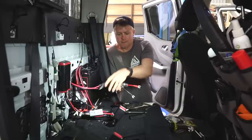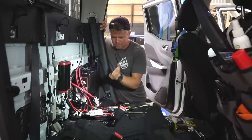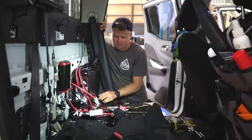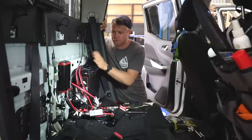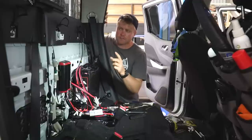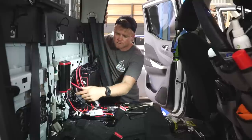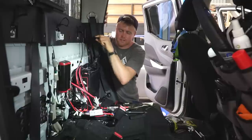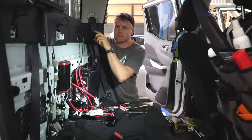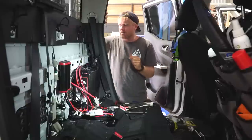By the time you wire everything, solder on your Anderson plugs, and put all your fuses on - the battery fits nicely here. It's just sitting there at the moment, kind of held in place by the seat mounts. We'll put some foam underneath to pad it, then put a strap over it to secure it, and the charger is just bolted in there. We're sending wires through the back to the fridge via an Anderson plug through the vent and through a hole already in the tub. We're also hooking up USB and 12 volt outlets in the tub, and running through the front to the inverter. Still got to hook it up to the main battery.